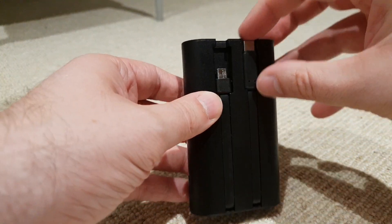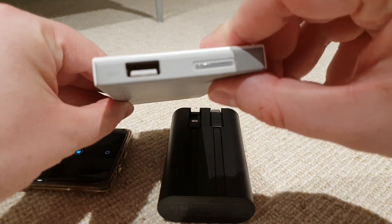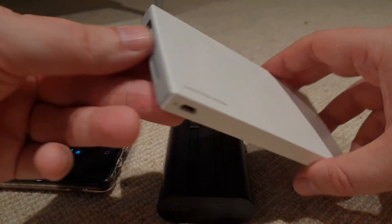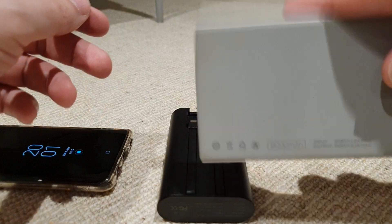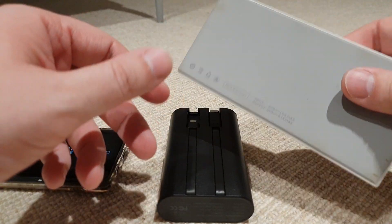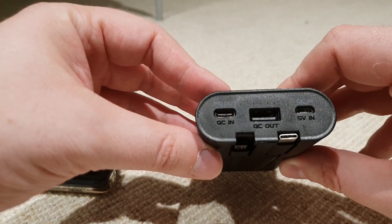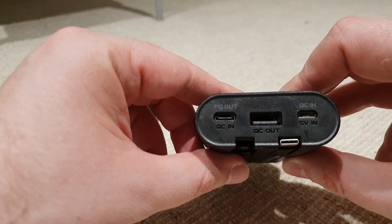They've also rather handily — and I do really like this compared to other power banks — this is my old power bank by EMI, which was quite affordable. It's a flat 8,000mAh battery, but I have no idea what the power amount is because it's not actually going to tell me, which is not very useful. So it's a nice design, but I wanted something with USB-C integrated and this Power Delivery output system, because this is a Samsung Galaxy which doesn't have a Qualcomm chipset and therefore doesn't support Quick Charge.